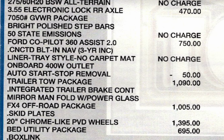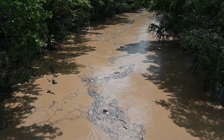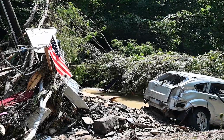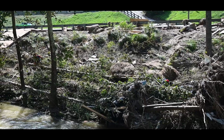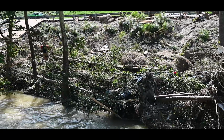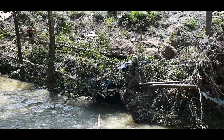When we upgraded the F-150 in 2022, the receptacle feature was one of the main considerations. We didn't try the receptacles until working the floods in southeastern Kentucky in August, and then, sadly, no go. The inverter just did not work. Our initial load was only a single tablet, 65 watt max. I plugged it in to charge while driving, and after a couple of hours when we stopped, nothing, no charge. The tablet was dead at 1%.